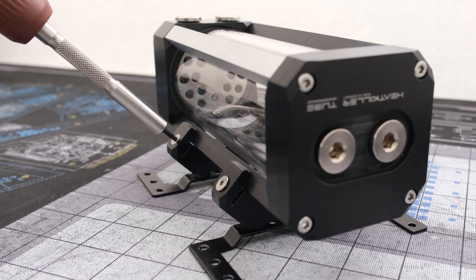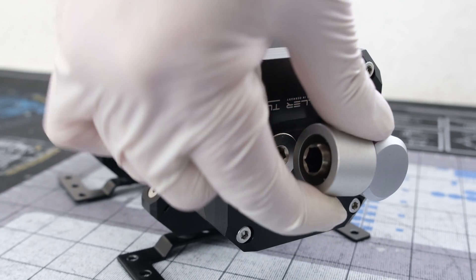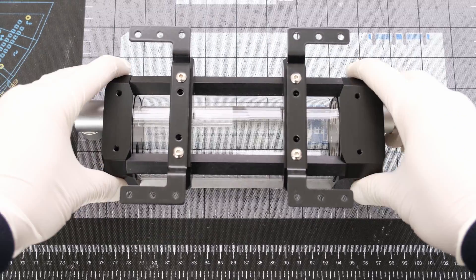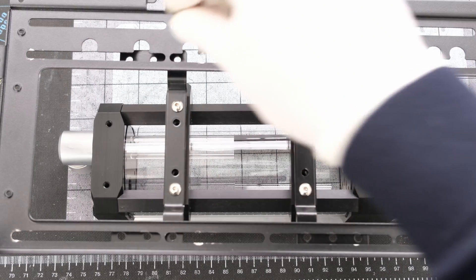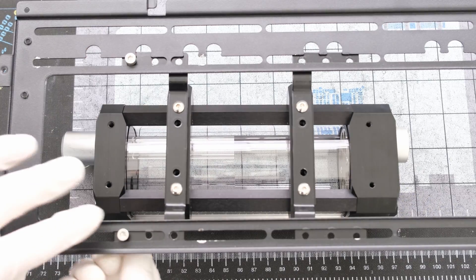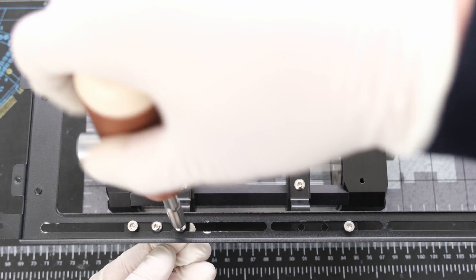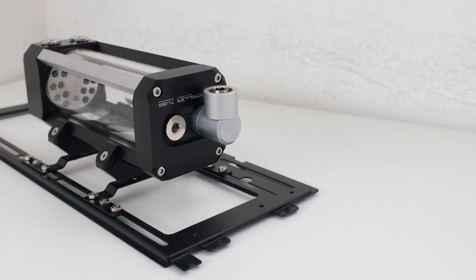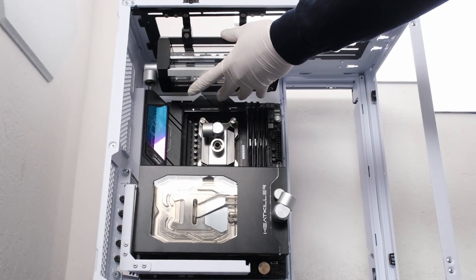On the other side, we will install a 90 degree torque adapter and a 16 by 10 compression fitting. Next, we'll secure the universal mount to the case bracket using a total of 12 hex screws and metal washers. By not having the pump attached to the reservoir, we can achieve a cleaner look and also position it horizontal and more in center view, showcasing the container for the liquid. Then we can slide the case bracket into place and secure it with two case screws.